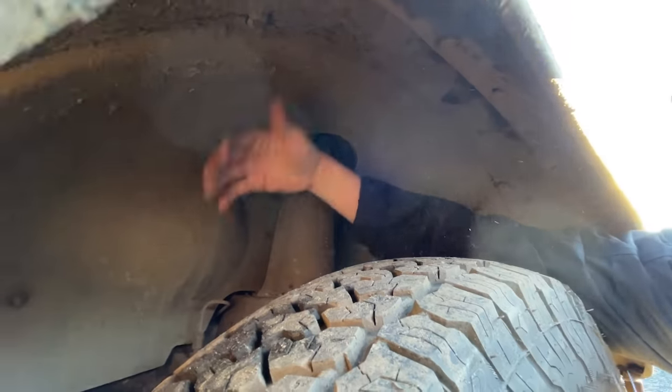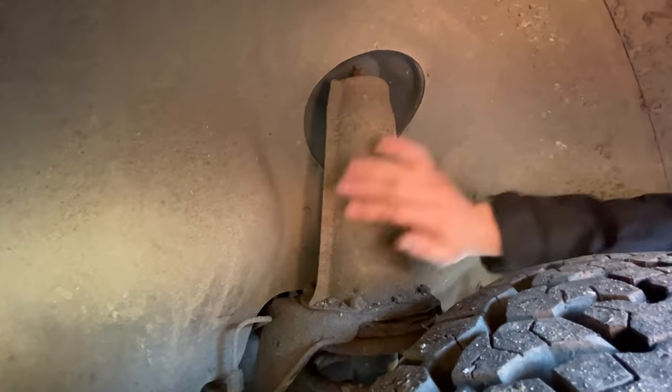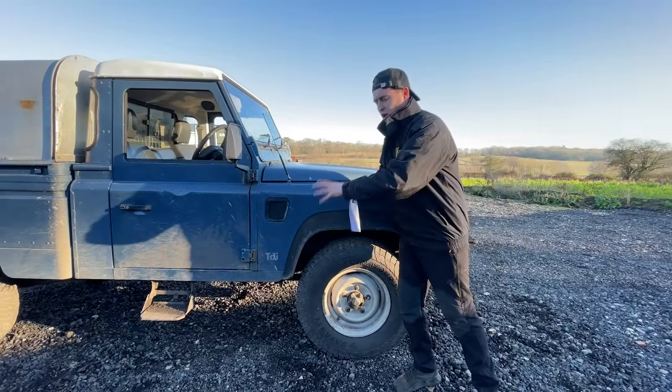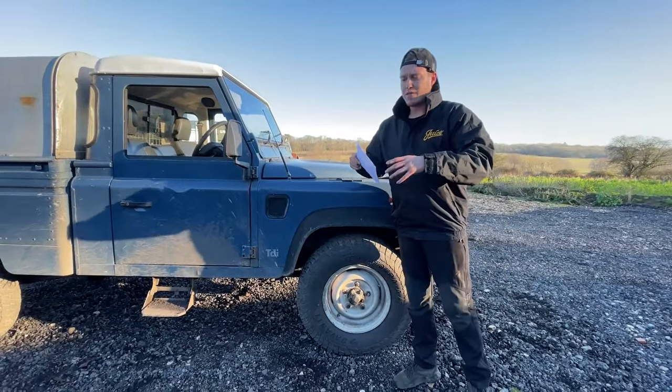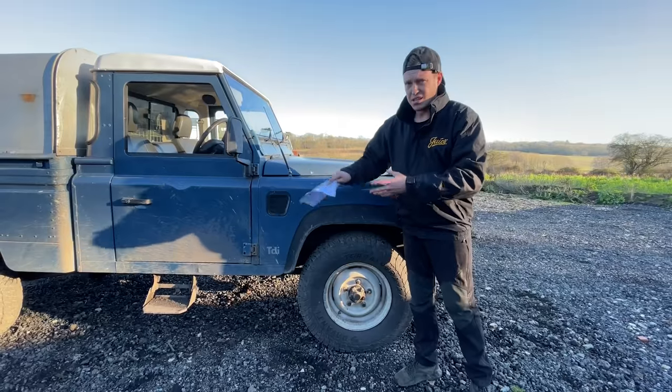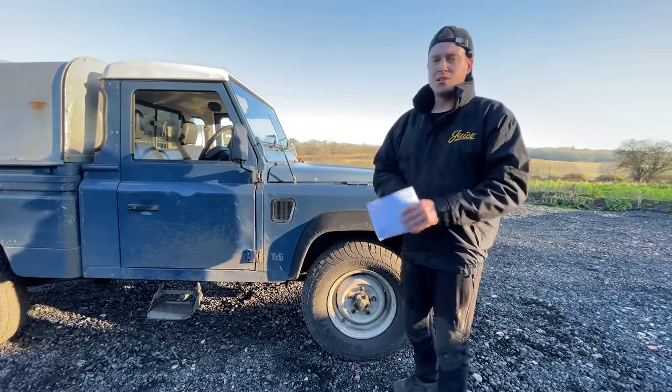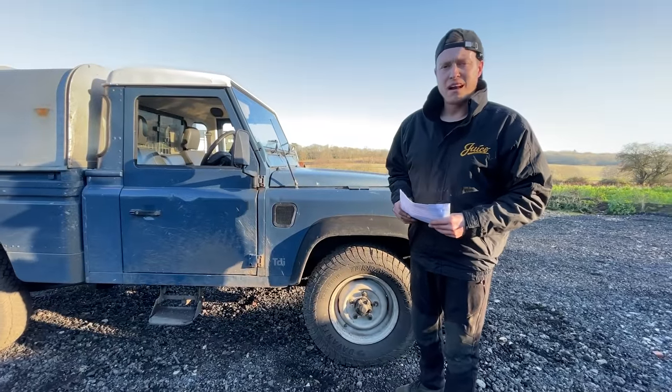Mud gets flicked up from the rear wheels, sits in the back of the crossmember and rots the whole rear chassis. It's a relatively savage repair - you've got to drop the fuel tank, cut the back of the chassis, cut the wiring, and weld on a good quality unit. Look in the wheel wells - on earlier vehicles the liners will be made of metal and might rot around the nuts and bolts. The suspension top turrets are where the shock absorber runs - the back of them holds mud and rots out. This one is nice and solid.